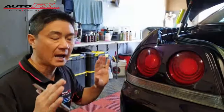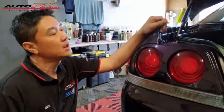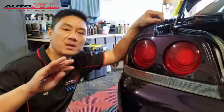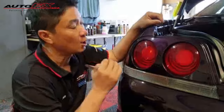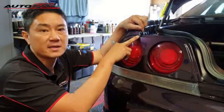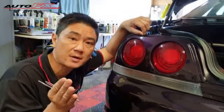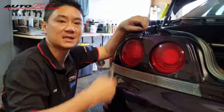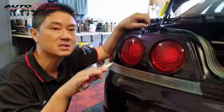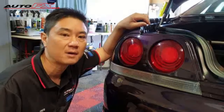We've done this whole entire vehicle by bulk fit, and what I wanted to demonstrate today is for anyone who's doing a bit of DIY PPF or just learning — you're going to come across little bits like these corners where there's excess material and you can't make it stick down because there's just too much material for the surface area. Normally if you had software or a vectorized pattern for this, it would already have a relief cut so you wouldn't have to hand cut it.